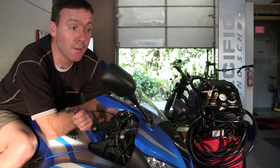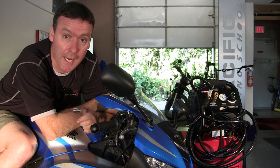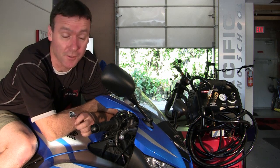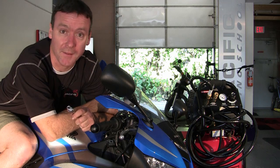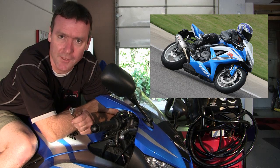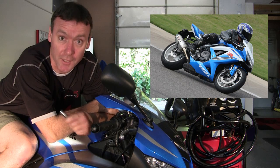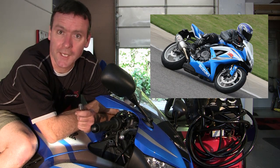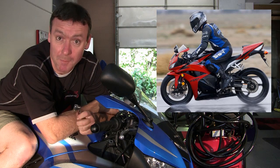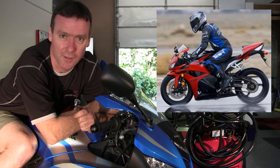Let's pick braking. Underinflated tires squirm too much, have too large a contact patch, generally slide, tire overheats. Not on my wish list. Too much pressure, tiny contact patch, tire slides, braking performance not there. Handling. Bike squirms with low pressure, tire overheats, doesn't want to turn into corners. Too much pressure, tiny contact patch, tire slides. Riding in the rain. Underinflated, closes off your rain grooves. Tire rides on top of the water, not too good for traction. Overinflated, tiny contact patch, tire slides.